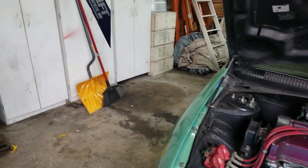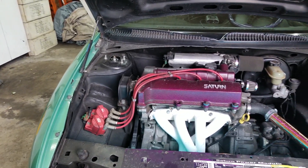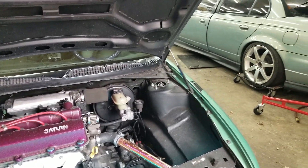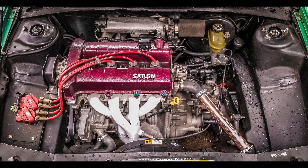This was the first Saturn ever wire-tucked. The whole engine bay — I got rid of all the fuse boxes, moved the battery to the trunk, and got rid of the power steering and air conditioning. I put a manual rack in for steering. Radiator reservoirs are tucked underneath the MSD coils. The MSD coils on this car are mainly just for looks — stock coils would actually outperform these — but I like how they look, and that's the only reason they're in the car, along with the MSD wires as well. The valve covers are currently a custom candy-coated high-flake metallic purple, sticking with the purple theme.